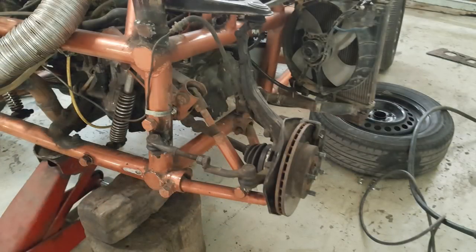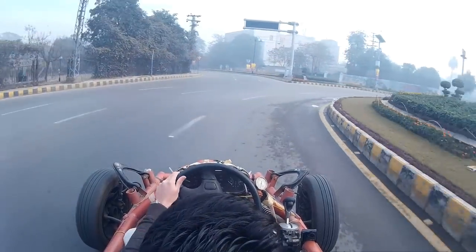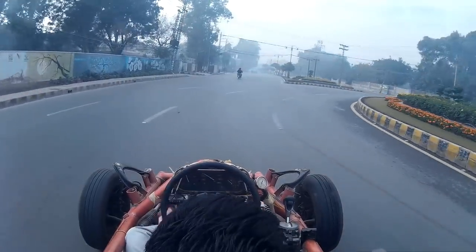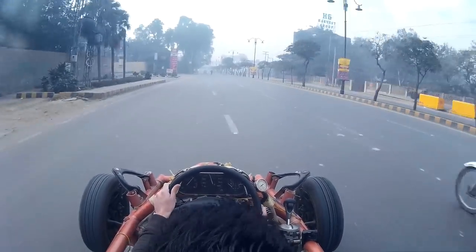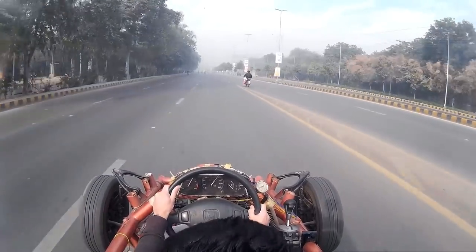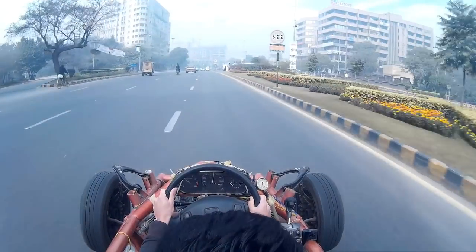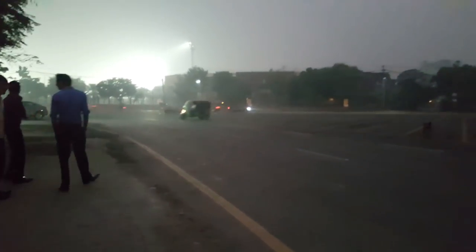Another change I made was moving the position of the ball joint on the rear tie rod end, because before the suspension had a bit of bump steer. Bump steer is when you go over bumps and the wheel moves up and down, it also changes the toe angle, causing instability. I changed the position of the inside ball joint by just about a centimeter, and it made all the difference — once I did that the car became really stable going over bumps and at high speed. I won't go deep into suspension geometry in this video, but I'll probably make a separate video on that. I already made a video on springs and anti-roll bars which I'll link in the description.